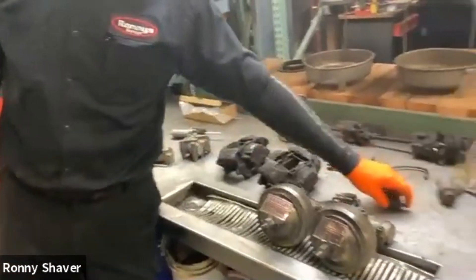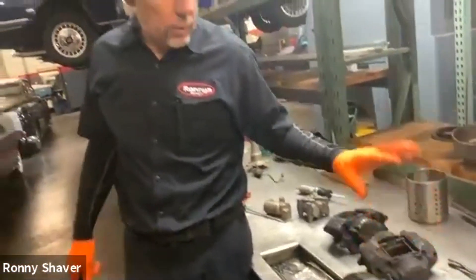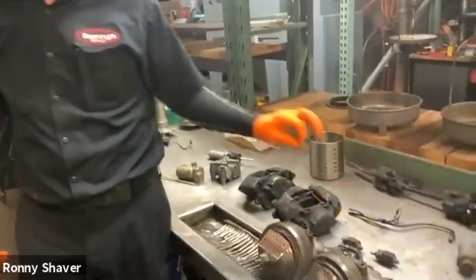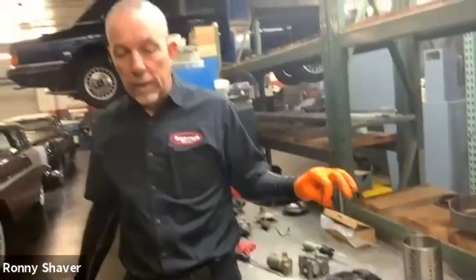I have seen a car like this where it had one brake pressure light coming on, even though it needs these. This is another part of the system — this brake pressure switch. What'll happen with these sometimes is, over time, they will get stuck. They either get stuck on or they get stuck off.